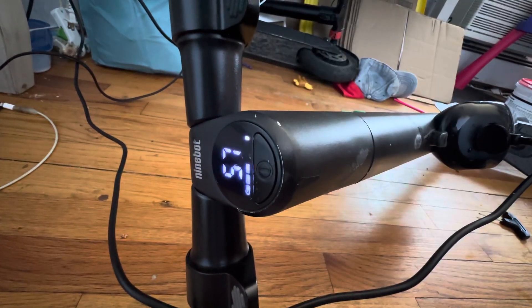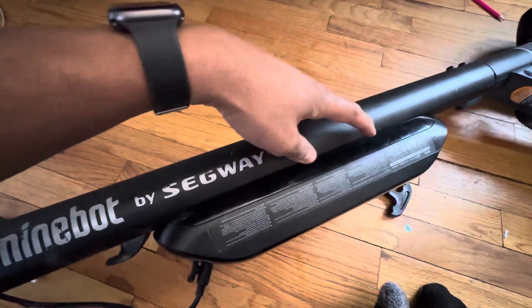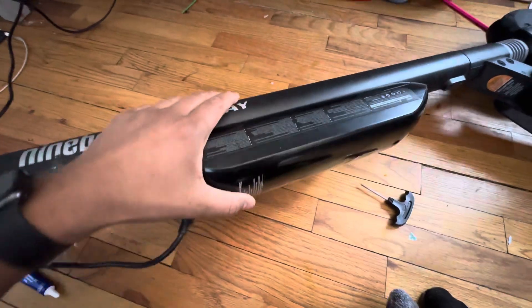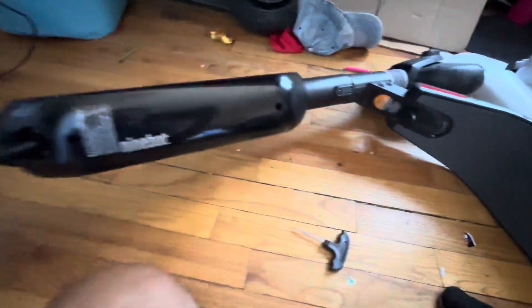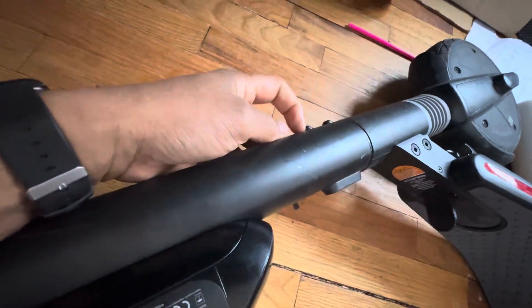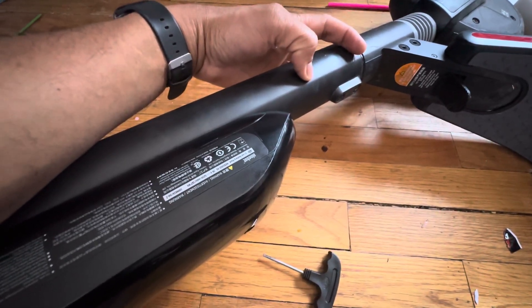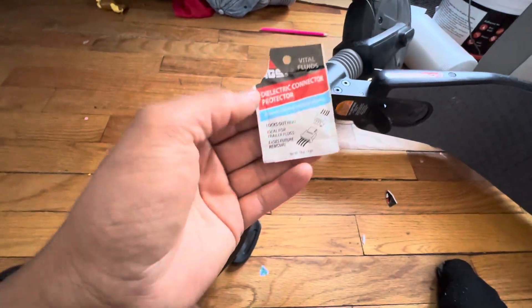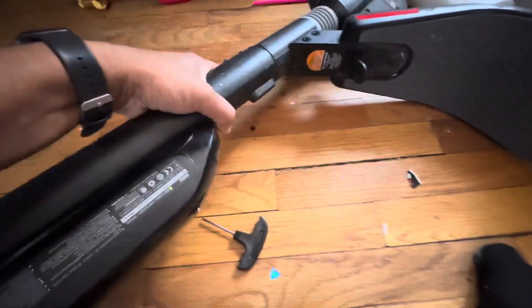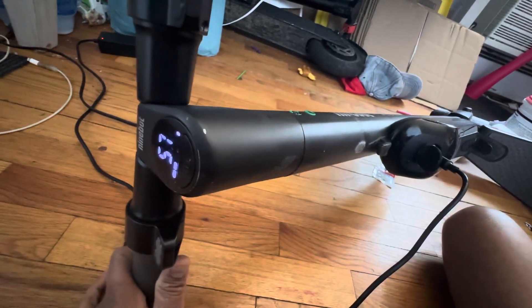So error 48 was the external battery being loose, and error 42 was a loose connector at the center. The simple fix: remove the external battery, remove the three bolts holding the external battery bracket to the body, and make sure it's straight and flush against the body. You can also remove the two bolts on the side to find about four wire connectors — make sure those are sealed well and apply electric connector glue. Seal it back and that's all — it's been working fine now with no more error codes. Thank you for watching, please subscribe and give a thumbs up!